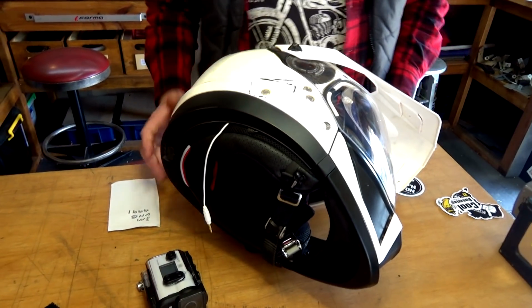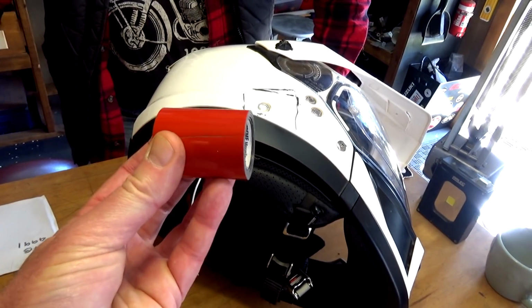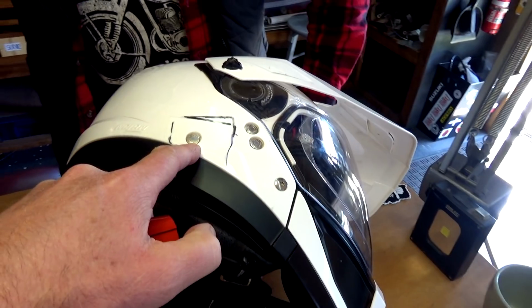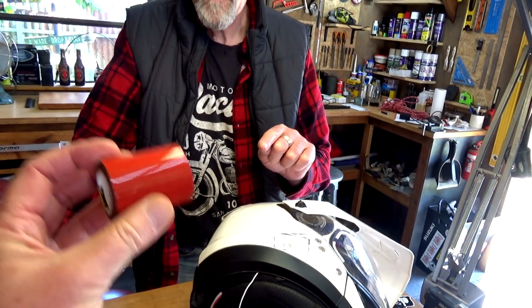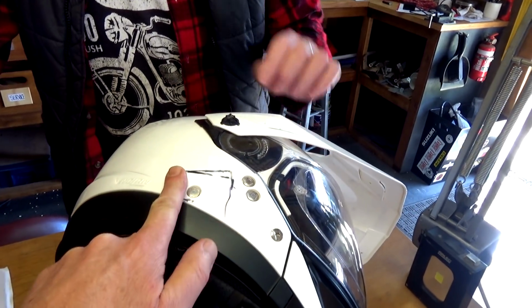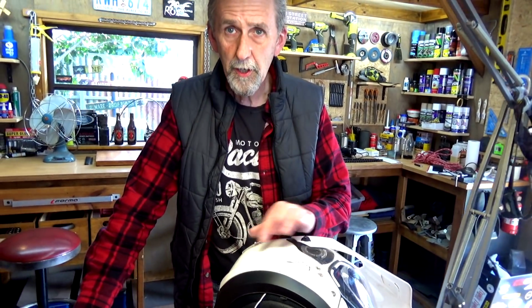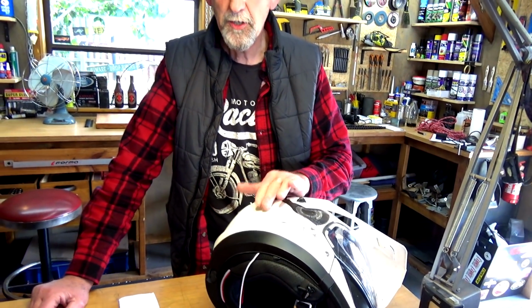So next thing is, now that that has been removed, we would have no problems of using the same double-sided tape, Scotch Extreme, and that should be no worries. We have to clean it, with the wax remover, obviously cleaning it and putting it back on like we did, because the weak point's already gone now. It's going to the proper base. It can't go down any further. There's no other coating, clear coating or gel coat to come off. Cool. So this is the best foundation for it.